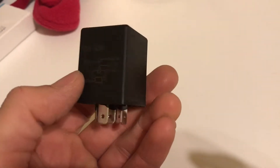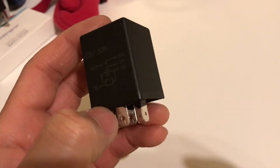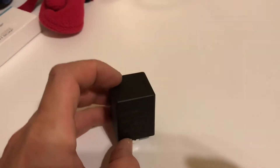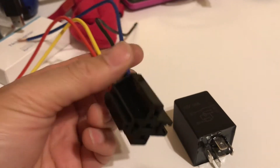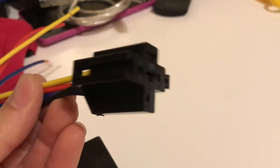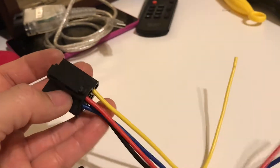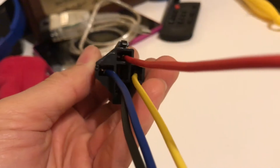It came with just the relay cube by itself — no wire harness or anything included. If you already have an HID relay with one of these blocks, you just pull out the old one and put in this one. But for what I'm doing, I've already got a relay set up in the car — a dual relay for each side — so I'm just going to use this time delay to activate those two relays. I'm using a standard five-pin relay harness; I had a five-pack and just needed the harnesses. I pulled out the center wire since I didn't need it — that's the contact point when the relay is at rest, which we're not going to use here.